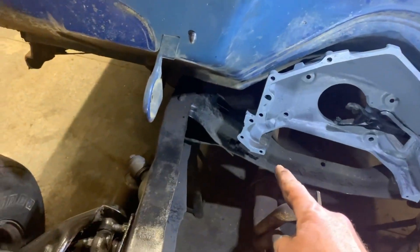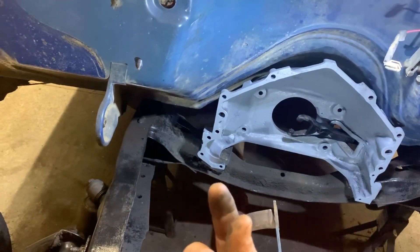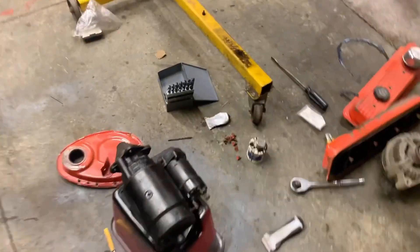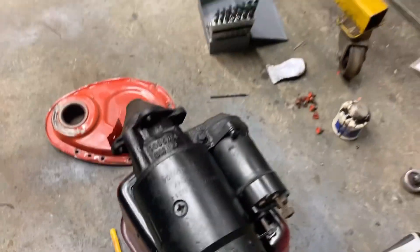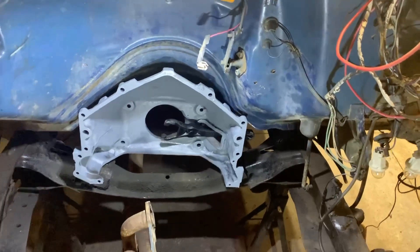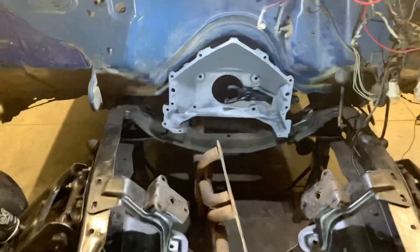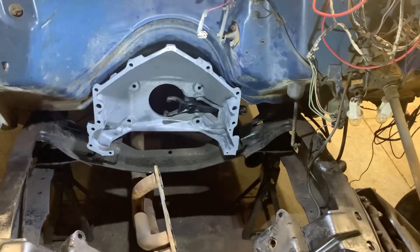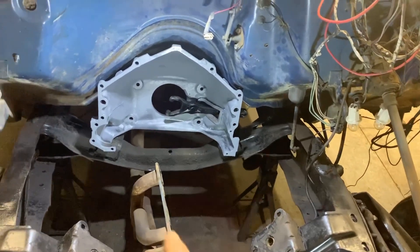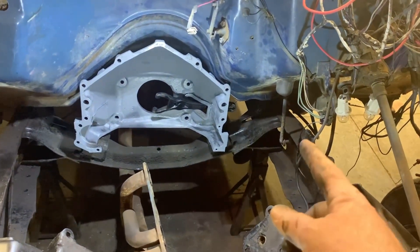The transmission itself bolts in those four holes and just hangs off the back. Your starter is going to mount onto the bell housing itself — unlike a typical small block Chevy where you have two bolts at the bottom, you're going to use these three. That starter is also from the inline six. You're also going to use the flywheel from the inline six — it bolts to the Chevy 350. So you're going to reuse the flywheel, the starter, the clutch, the bell housing, the clutch fork, the z-bar, and all the linkage.